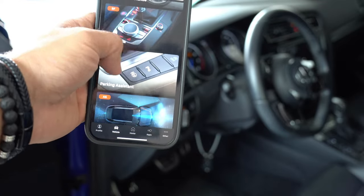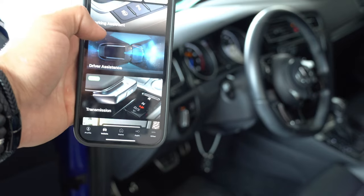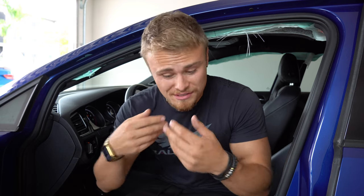Gateway, steering assistance, multimedia — which is a fault code on basically all Audis — and driver assistance from the rear end being damaged. Those fault codes don't seem too bad. I'm still so relieved we went from 118 fault codes down to only 46. I'd say probably about 10 are just error codes that will clear once we start fixing other things, but the majority of the faults are from the airbag stuff.